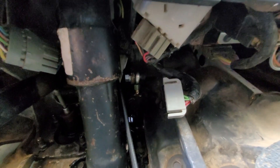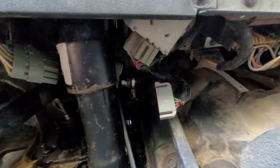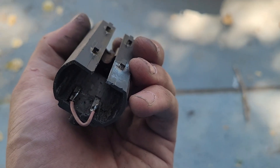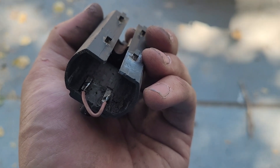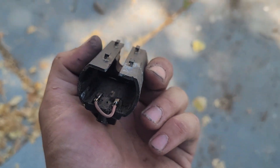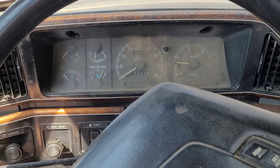We may be bypassing the safety switch. Everything's bolted up and you can see the safety switch is interfering, so we are gonna have to bypass it. Not really any way around that, so I'm gonna pop it back off and figure out how to bypass it. I just went ahead and dismantled the switch and put a jumper in between the terminals - that'll let us start it up and drive it at least. I'm interested to see if the cruise control is still going to work. We can't even test it until the speedo is fixed, so no big deal. This will get us there for now - it is a big improvement because it actually returns to the top.